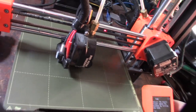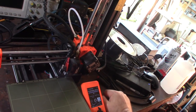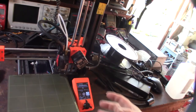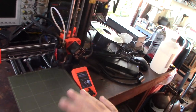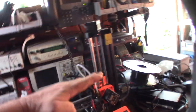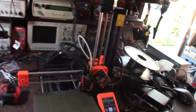I've got to figure out why it's way off. You have to picture yourself as a customer — they're not going to know G29 or these different commands. You have to think about what they're looking at and what Prusa's documentation tells them. Trying to get this leveled in a way they can figure out. The bed is probably sagging on one side — tighter on this side, loose on the other. That's normally what the probe sensor is supposed to correct for. I added a G29 command to my G-code.